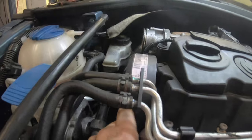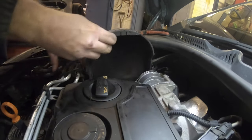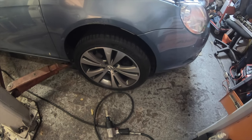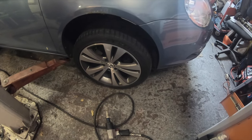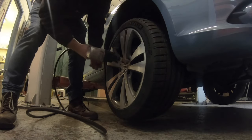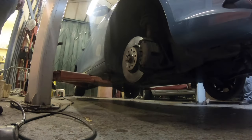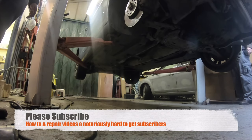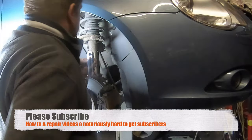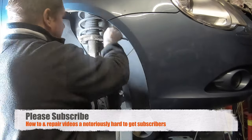There's a clip at the front and another one at the back. Once you remove the timing belt cover you can lift up the car onto jacks and remove the wheel. This gives access to the splash guard. I have a two post lift so I'm lifting mine up, but it can all be done on jacks. Remove the splash guard to gain access to the lower half of the engine.